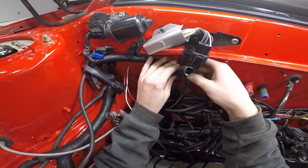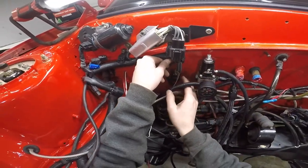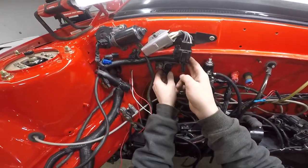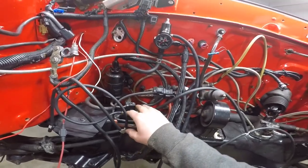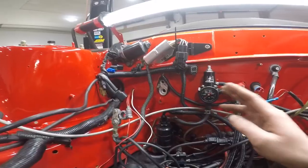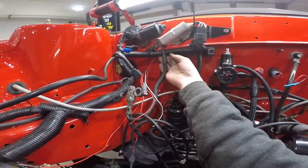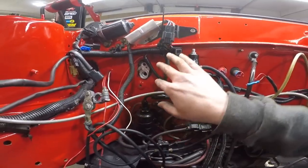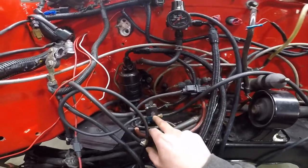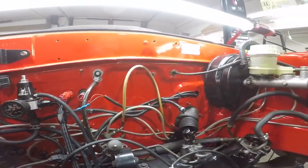Now I gotta be a freak and get everything hidden back up where it needs to be so you can't see any of this. Get your wire loom on - this can go up there and be zip tied in. All of this goes back behind it so you can't see any of the bits. I actually ended up disconnecting it again off camera because I wanted it all ran behind these wires - I had run it straight down like an idiot. I redid everything, but there you go: heat shrinked, everything zip tied up. Once the battery and everything's in you won't see any of these. I took this off and got it zip tied to this ground down here. I want this as clean as possible.